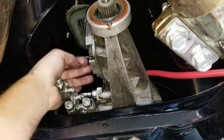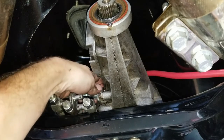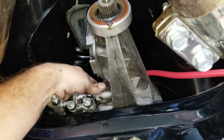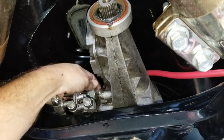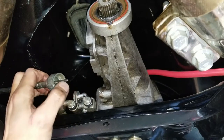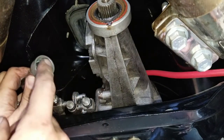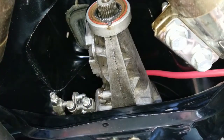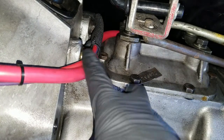While we're here, this is the speedometer cable that goes into the transmission and it should just screw off like that. See - it's just a little square-ended cable. That's called mechanical; electrical would mean you have wire signals talking to your speedometer, but that didn't exist 50 years ago.